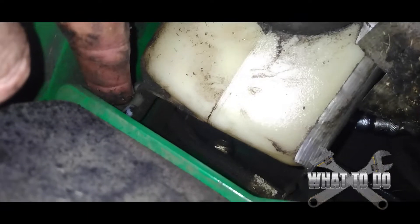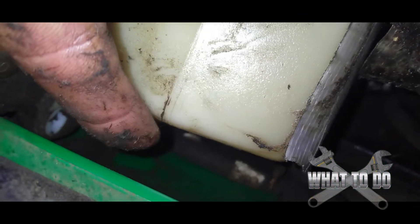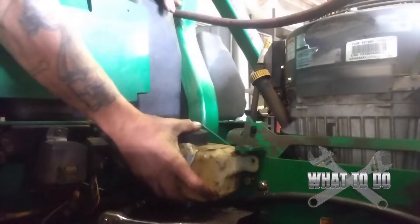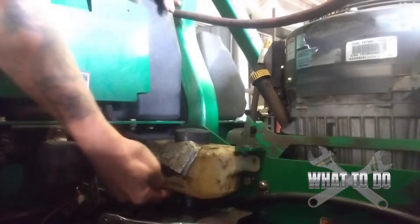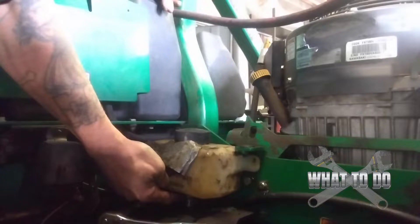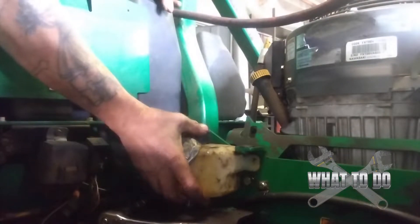Just use your finger — you won't need a wrench to get back there — and you'll be able to get that nut off pretty simply. Same thing with this one. You're pretty much going to drop that nut, which we did — you can see it fell down in there — but you can leave that and we'll get it out once we pull the tank up. The nuts are off and the tank is loose, so now we just have that clamp holding the hose on. We'll use our 8 millimeter on that clamp, loosen it, and then we'll be able to shimmy this up and off of that hose.